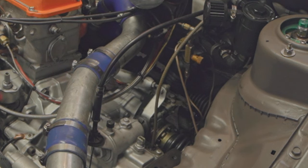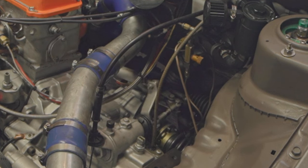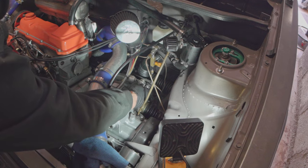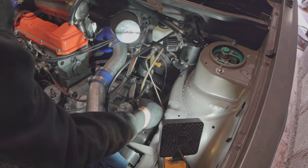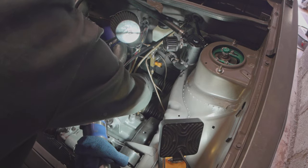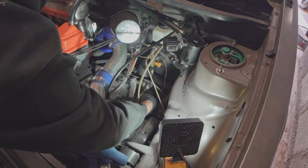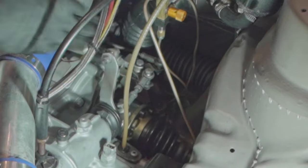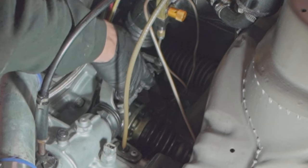Then of course reverse is down all the way over and up — there's reverse. Essentially, the problem is this motion is lacking some precision. It looks like the first thing that might be wrong here — this is a heim joint linkage, so I already upgraded my shift components over stock, which normally they're plastic. They're better, but they're not perfect — strictly okay. This first link here, which definitely has something to do with that motion, has some slop in it and it's not quite tight. So I'm gonna go ahead and take it off and inspect it.